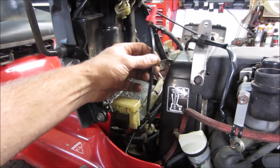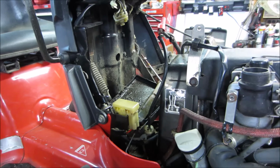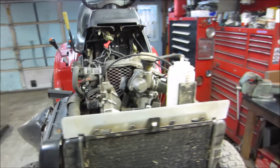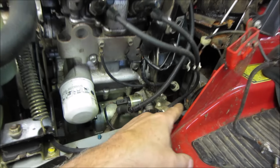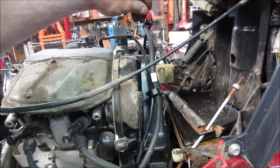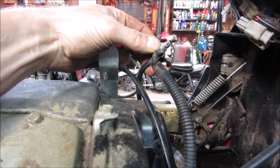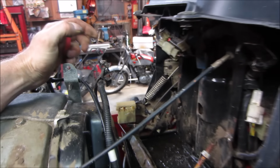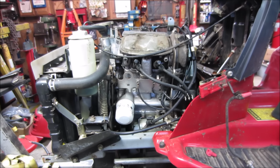So I'm over here on this side of the battery and I do not see a terminal that would have gone to the positive side of the battery at all, unless there was something on there that broke off, but it's physically not even there. Again, it has this one. This is the ground side of things. You follow that down, it runs down to the frame, but I do not see anything on the hot side other than here. So we're going to open that up. We'll put the jumper pack. I thought that was the end of the terminal. Looks like somebody ran some solder around that. Yeah, we're going to use that for the jumper pack, and we'll put it on there and see if we crank it over what it sounds like.